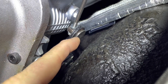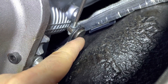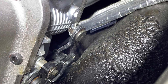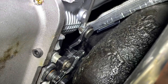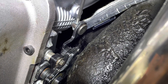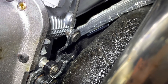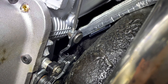This piece here is just knurled inside, so it's really just a press fit. When I had to put it back in, I just used a couple of pairs of vice grips and squeezed right here to pull it back in. I thought I'd show you that because I haven't found any videos of people specifically showing how to mount this into a New Edge SN95 Mustang, so hopefully you find this helpful.